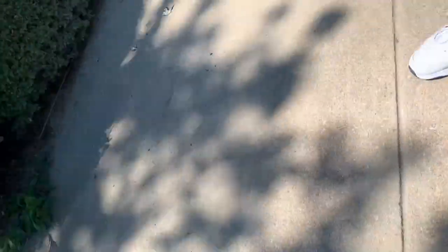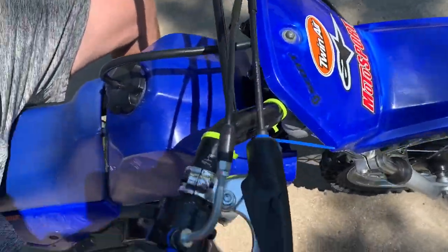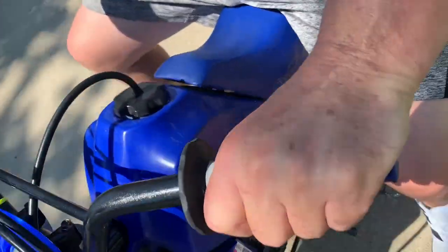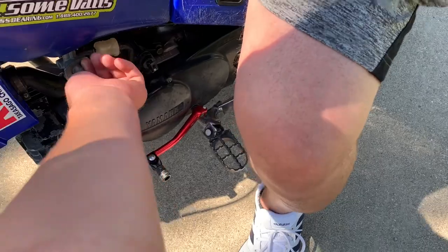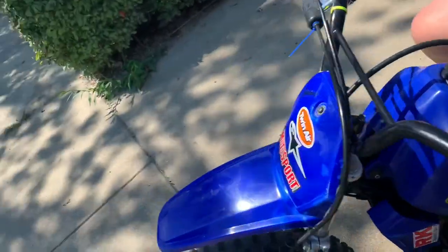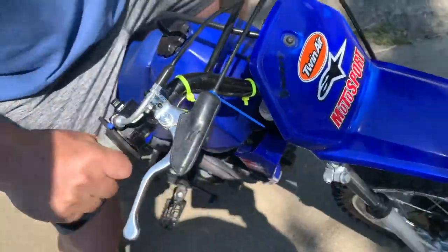It's like a car. You start it with the kickstarter — this thing. Yeah, it's cold right now, so you gotta turn the choke on; choke's right here. The gas is right here. Don't drive with the choke on. You're gonna have to give it a little bit of throttle when you stop. There you go.